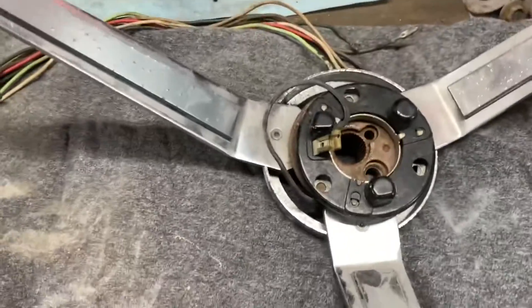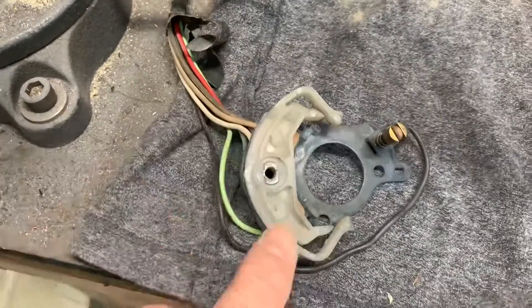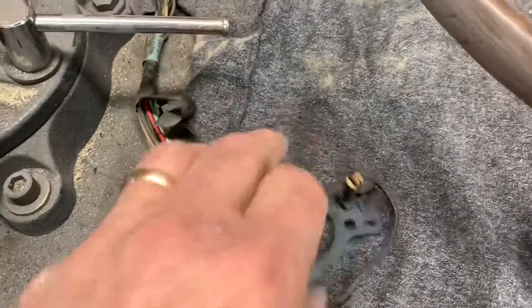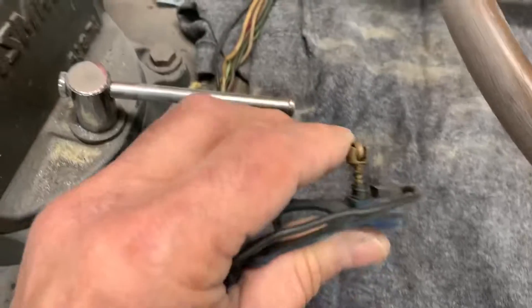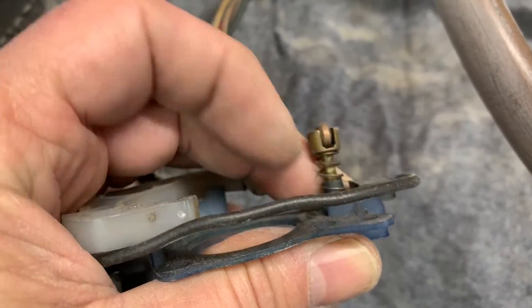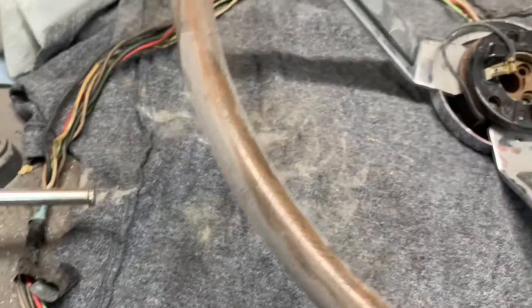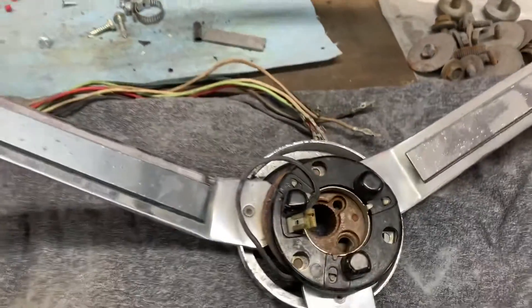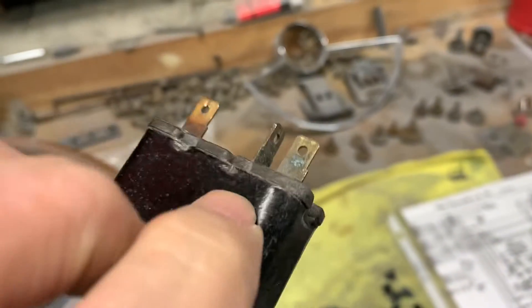So what are some of the common failure points? This can be a problem with the cam cancelers for the signals, but not so much for this. If this is corroded, if this spring is broken and it's not pushing up against the back side of the steering wheel, this could be one possible failure point. Corrosion here, obviously, could be one spot. Connectors, bulkhead connectors — those are obvious first places to check. Your relay itself, how the terminals look — easy things to check, easy to clean up and fix.